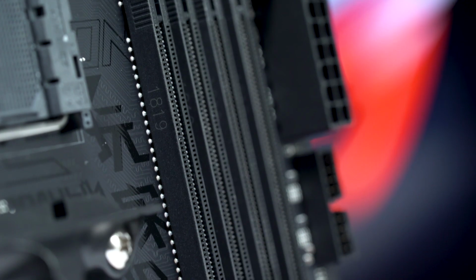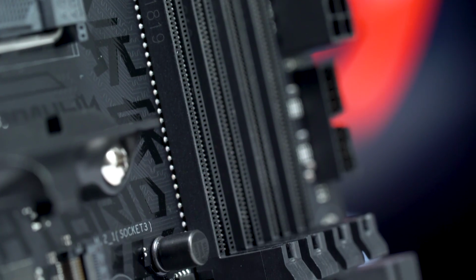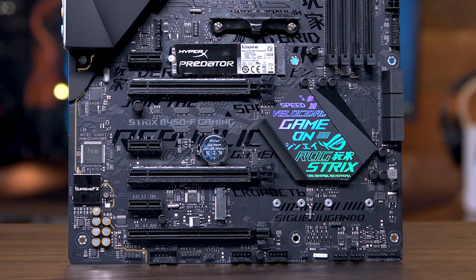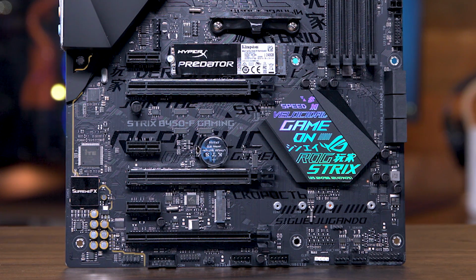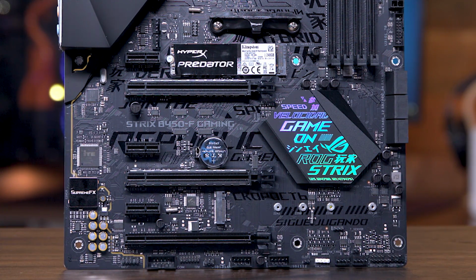Now, all of these features and functions that this board brings to the table are great, and there's actually quite a number that we still haven't even noted. But definitely at the core of any type of PC DIY build are, of course, your standard specifications, and this board's got you covered in terms of all those key aspects. You're going to have great high performance 4 slots in terms of DDR4 compatibility. You're also going to have 2 full x16 slots, and the way the board's been configured, it can support CrossFireX-based configurations.